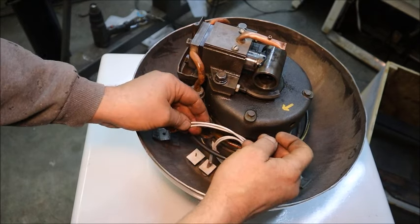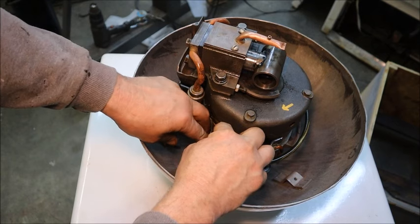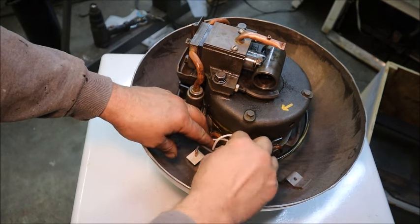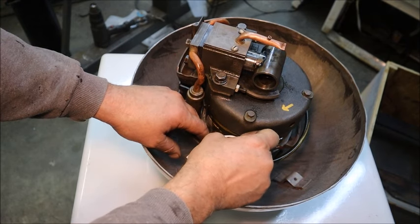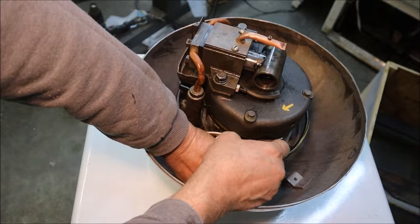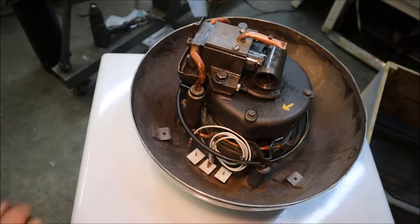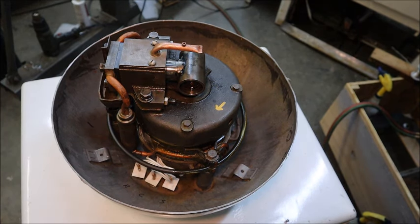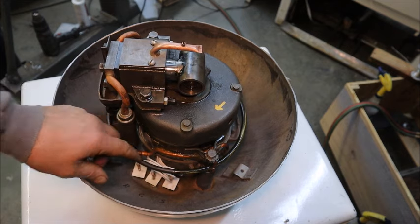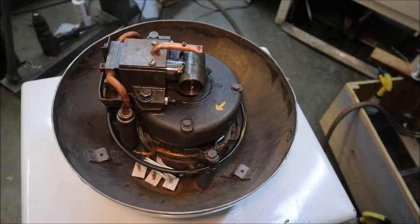These electrical terminals sit over the studs, and I've got to look at the bottom to see how they're labeled, but the general idea is that they're going to sit over there and be soldered. Once that's done I'll take lacing string to bind them up so they're not going to vibrate, but they need to have a loop in them just like the discharge line - they've got to have a big loop to prevent fatigue as the compressor moves on the springs. Everything is together - wires are soldered in place and coiled up back here. Those wires are pretty stiff, they stay the way you bend them, so they're going to stay in that little area and not be a problem.